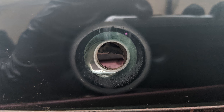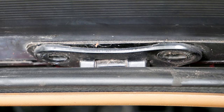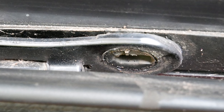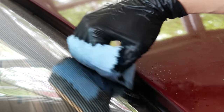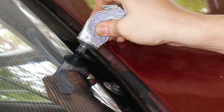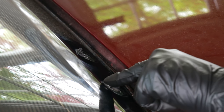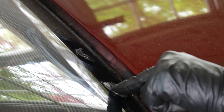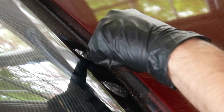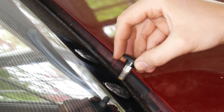The hole that the bolt passes through in the hinge is slotted, which allows for some side-to-side adjustment and holds the hex part of the bolt to keep it from rotating — that's how we're able to tighten the bolt without holding anything on the other end, and it'll keep the vinyl electrical tape from being moved around. Before reinstalling the bolts, we're going to apply a little bit of RTV at the top of the glass. This isn't necessary for keeping water out because the bolt holes are on the outside of the weather stripping, but it could keep water from corroding the bolts and help prolong our vinyl tape spacer. It could also help keep the bolts from sliding on the glass. Once we've let that sit for a minute or two, we need to reinstall our bolts.